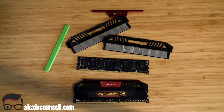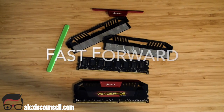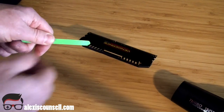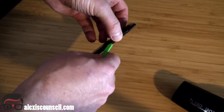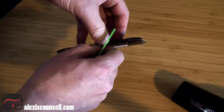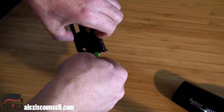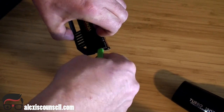Okay, so we're going to turn this on. You want to hold onto the RAM because it's going to start blowing everywhere. If you've got a heat gun you're not going to have that problem. I'm going to fast forward because this is going to make a ton of noise. Okay, this is getting really hot now — we've done this for about 30 seconds to almost a minute. So we're going to start to pry the top of the RAM open a little bit and see if we can get it off. I'm going to start with the sides — it actually is really hot. Ouch. You can hear the glue creaking.